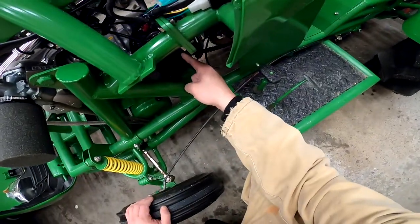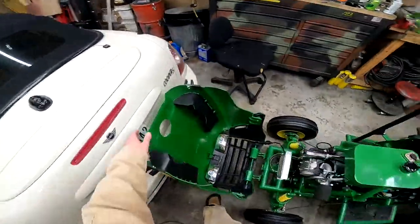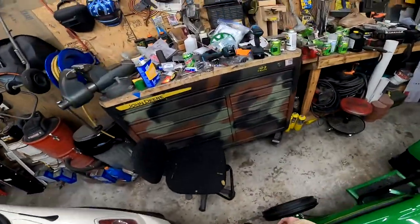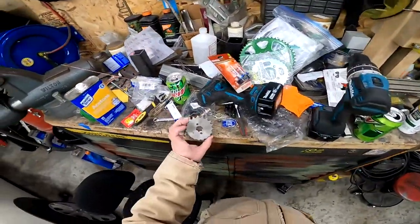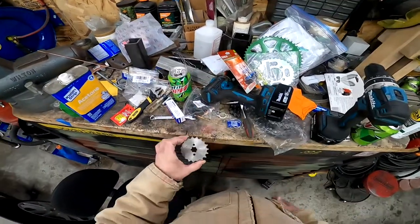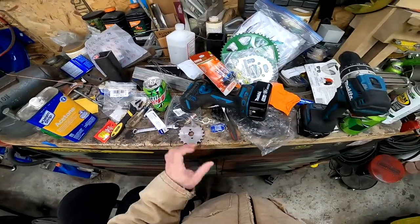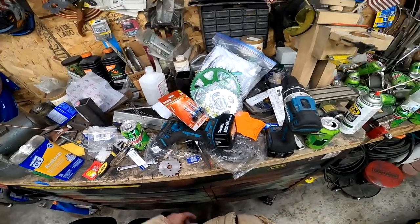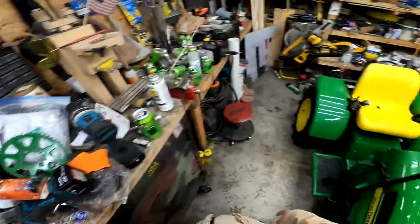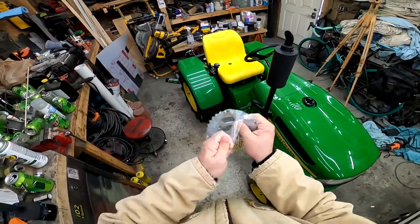I also got a 19 tooth for here, but the 19 tooth will not fit. So currently I want to say it's a 14 tooth on it. So I ordered a 16, but this 19 is just too big. The chain won't clear the part of the motor there. So a 16 should be two teeth less. It should be a little smaller. Hopefully the chain will clear things then and I can use that. So like I said, I already changed out my back gear before that last run, before my first plowing actually. So